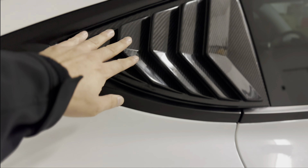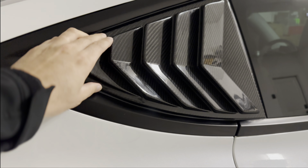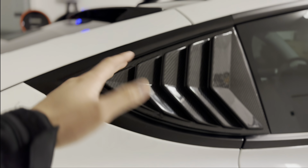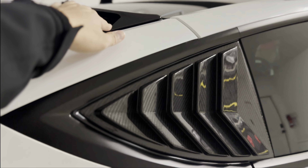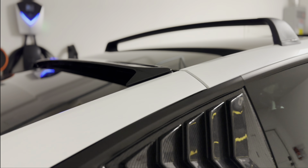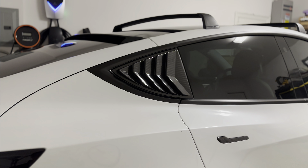Again, this is from PimpMyEV — full carbon fiber, real carbon fiber, no fake ABS plastic. It's very lightweight, held on by adhesive that comes with the carbon fiber piece, and installation took less than a few minutes for each side. You do have to clean the surface with isopropanol — 70% alcohol and 30% water. It just goes well with the roof spoiler and I think they complement each other. Note: the roof spoiler is not real carbon fiber, it's just a gloss lightweight ABS plastic. So if anyone has a real carbon fiber roof cover they want us to review, please hit us up on Instagram — link in the description. Thanks for watching, catch you all next time.